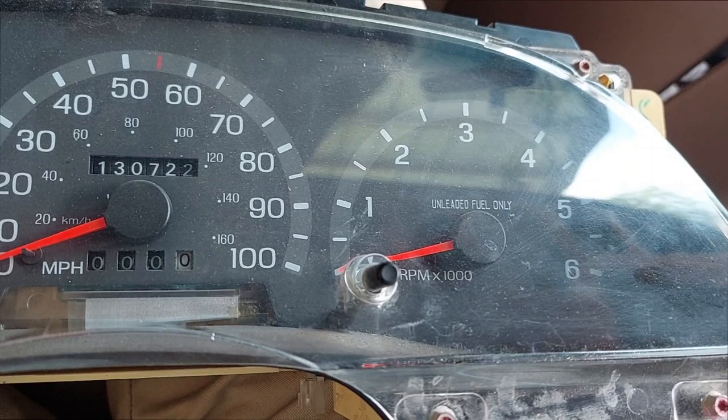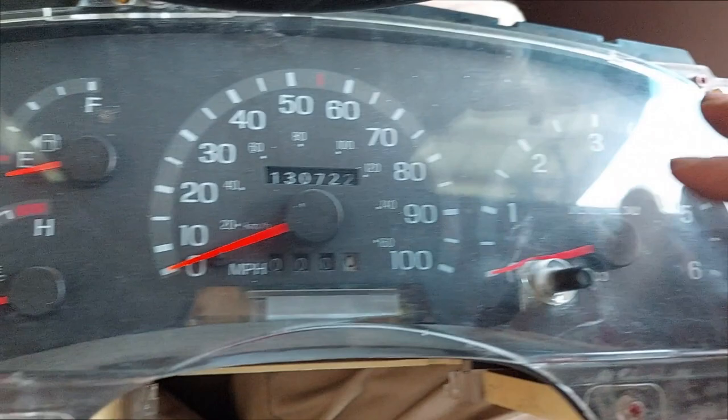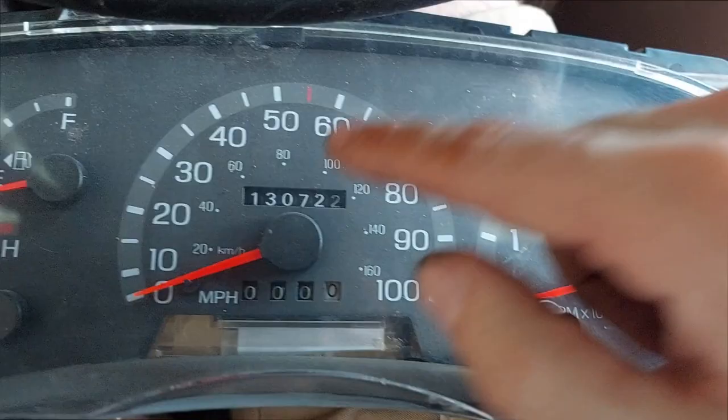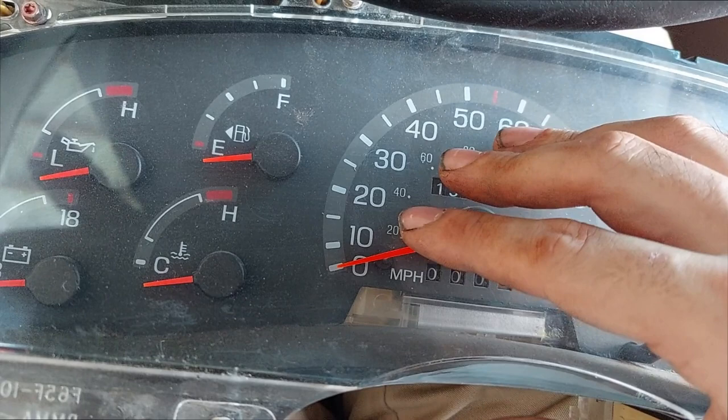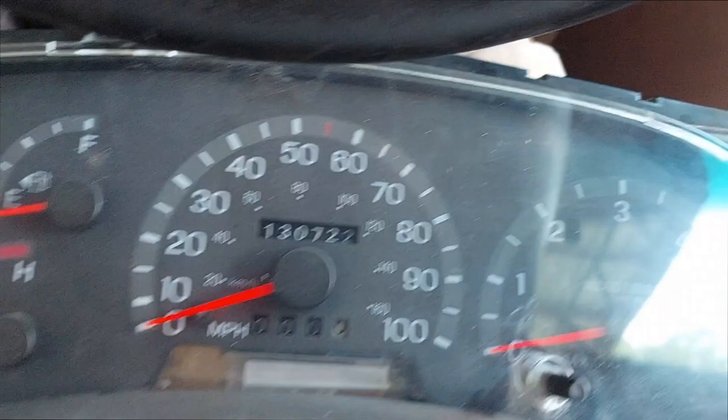This cluster is from a truck — it actually looks just like the one in my 2001 F-250. Your gauge cluster has the speedometer here and the tach there. We're going to go ahead and get in there and verify — I suspect the worm gear is in sad shape, which is why I have a Dorman replacement gear, part number 926-321. We'll go ahead and replace it so I don't have to worry about it for another 150,000 miles or whatever.